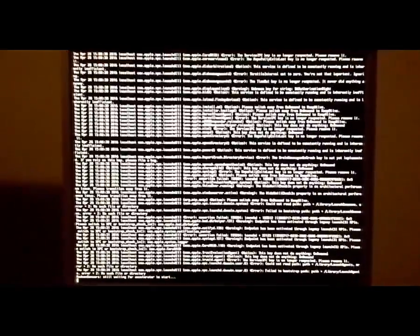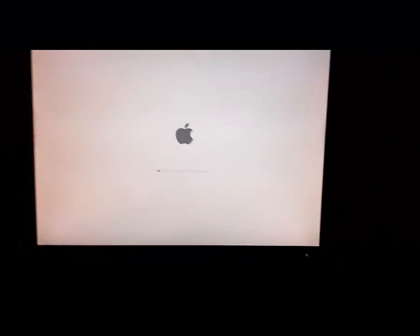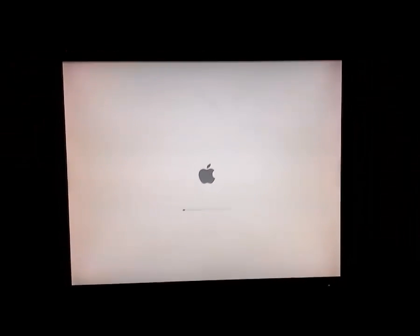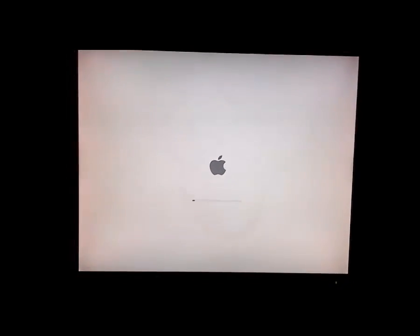After about five minutes, the booting process started, and as you can see everything is working as it should — no errors, nothing wrong. An important tip: if you have a Radeon graphics card with dual BIOS, don't forget to try the first and second position of the BIOS switch. My card didn't work in the original BIOS position; I had to switch it to the second position for it to work with El Capitan.